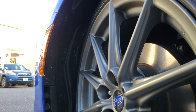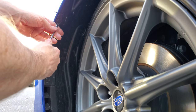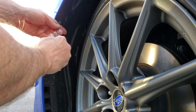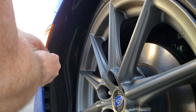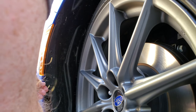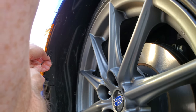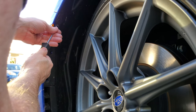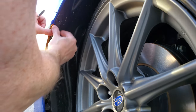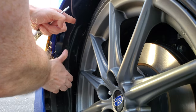We got the day off today, ran some errands, and we're going to do these hopefully before we run out of sunlight. We're doing the side markers — we got the JDM ones. To start, you just need to push these three tabs in with a flathead, push them in to unlock them, slide underneath, and they'll pull right out. One, two, three, and the cover should open.